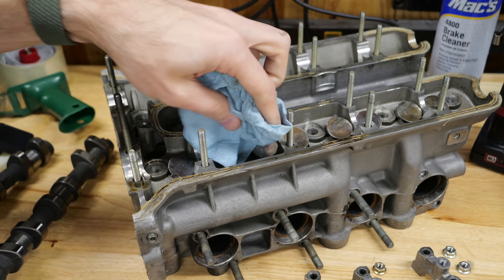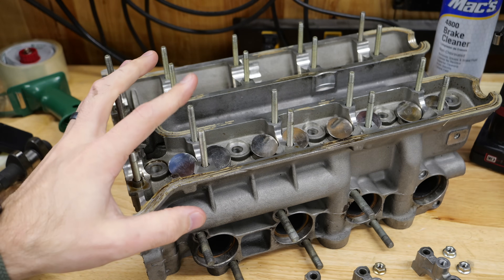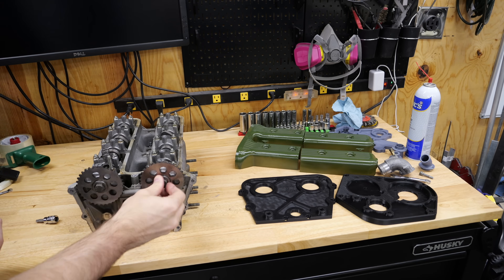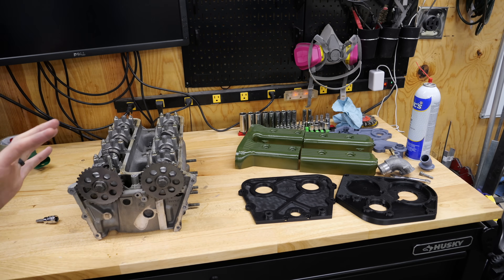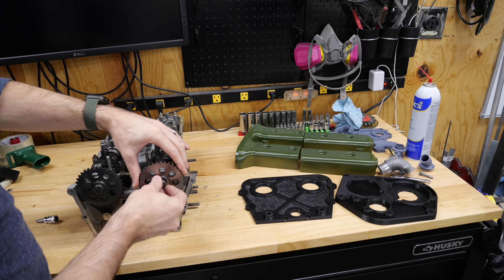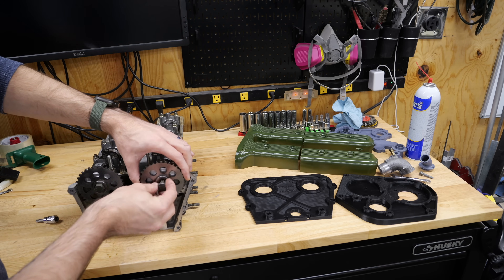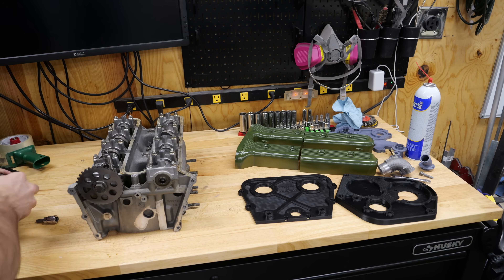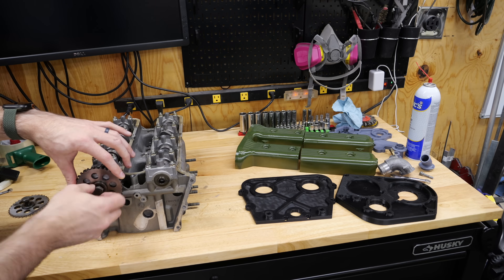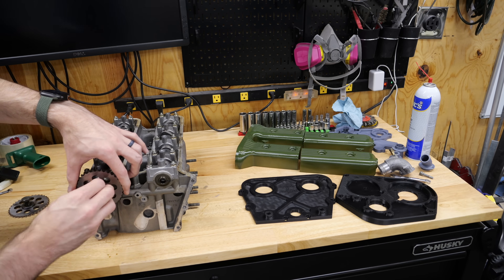With that out of the way, I'm going to go through and clean these covers and put the cams back in for now so they don't get damaged. I want to show you some of the 3D printed parts so you can get an idea of what this might look like after it goes onto an A-series block. I want to stress these are all 3D printed parts and prototypes. The first thing I'm going to do is take off these gears that are on our camshafts, because these are not going to get used in the conversion — these get converted to a belt drive system, with two pulleys and a number of tensioners and belts all the way down this side of the engine.